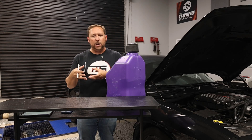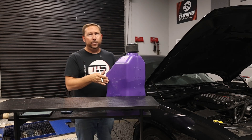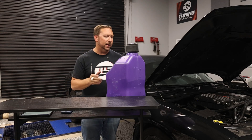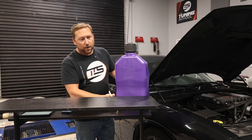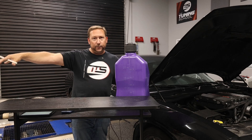There's no knock, but when you go any further, we start to see some knock. E85, as you buy it from the pump, probably isn't E85 — it's probably more like a 60% concentrate, depending on where you live. What does that really mean? That means if it's E60, about 60% of it is ethanol and the rest is 87 octane. That's how the traditional pump gas guys do it at the pumps.